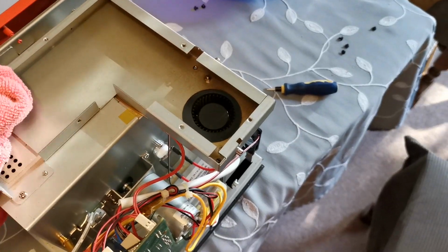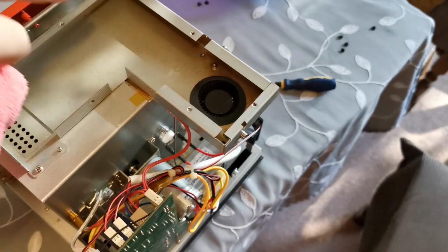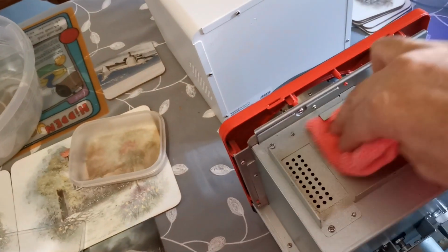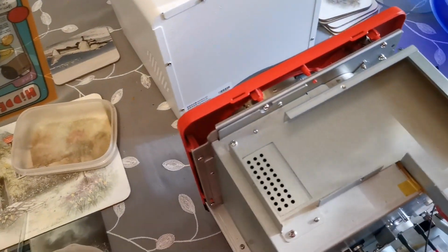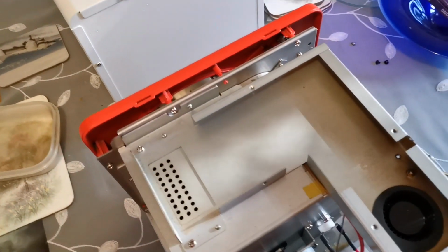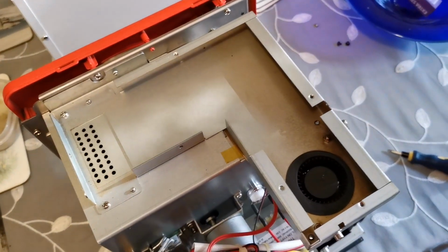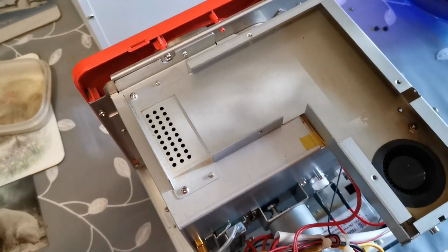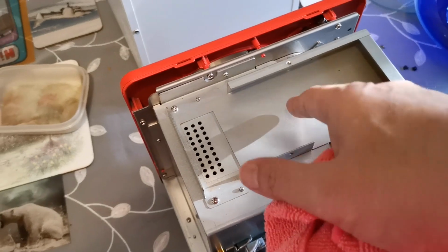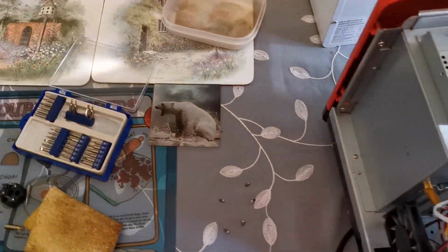That's not my objective. What I'm trying to do is remove any deposit that's on here, any build-up. It looks like flock wallpaper, the coffee roasting stuff when it builds up. And that's what I'm trying to get off. The fact that the metal's stained, I don't care. I'm not going to sit there with abrasive or heavy cleaners trying to get that off. The air can still flow over it. That can go as dark as it likes. I really don't care. It's any build-up that gets it, like some flock paper build-up.